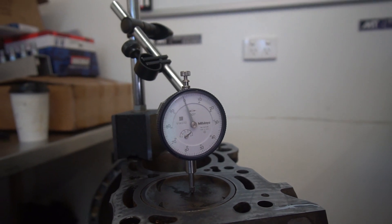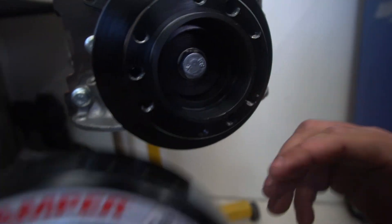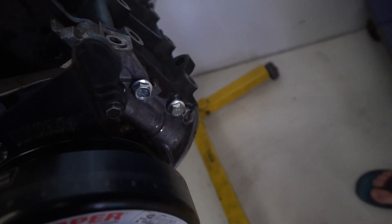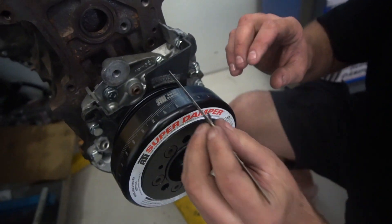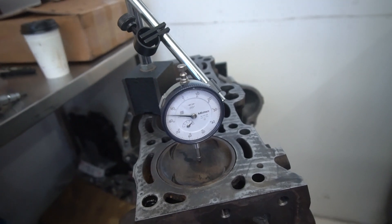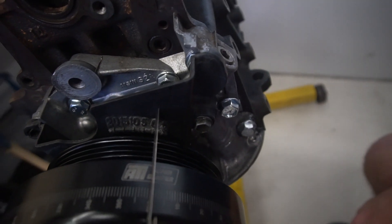Now if I put my harmonic damper ring on — on these they're marked. Here you have an offset hole, and here on the damper that offset hole is marked just with a pin punch or a drill. So let's move this around, bolt this on, and double check that everything lines up. We're just shy of top dead center now. So if I line this up with our top dead center mark and wind this over, watching our dial gauge — I won't even look, I'll tell you when I'm at top dead center. There. Right on zero — top dead center lines up with zero.